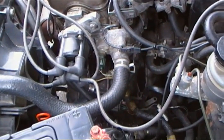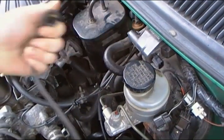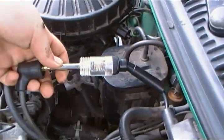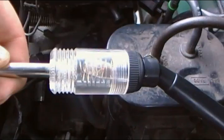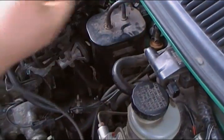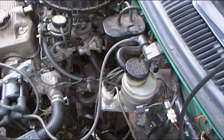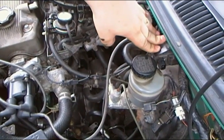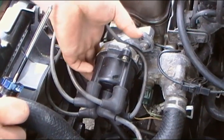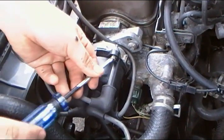So now I'm going to check if the coil is damaged by checking the power coming out of the coil. We have no power going to the distributor from the coil, so now I'm going to check if the distributor is sending the signal to the coil. I'm going to take off this screw and the screw underneath on the distributor to check if the rotor arm is spinning.